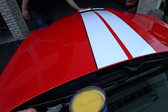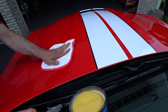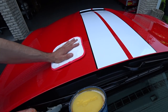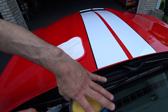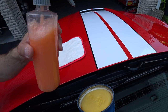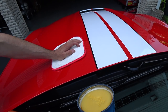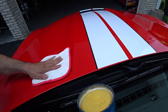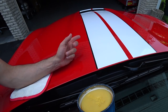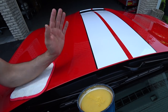The driver's side of my hood is flawless and we're going to repeat the process on the other side. I hope these tips help. A lot of people have been asking about 915 application and prep — just make sure your surface is clean. If it needs to be clayed, clay it with 3M professional or Meguiar's professional clay and use VO7 as your lubricant. I use it for claying and color sanding — it's amazing. If your paint needs paint correction, do it — don't rush it and don't use cheap liquid waxes or spray waxes.